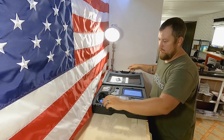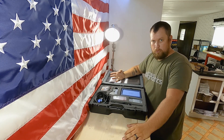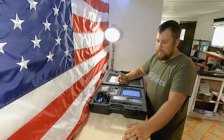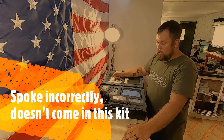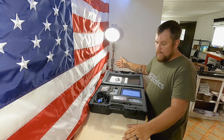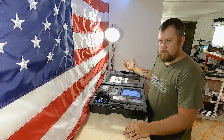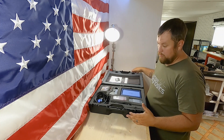This is their standard kit. It comes with four normal scope leads, a high and low current probe. It also comes with an ohms lead, and then it also comes with a high resistance lead as well for checking flex ray or anything that's going to be sending out a lot of power.